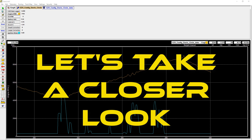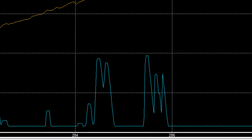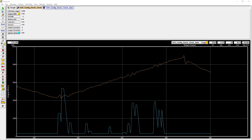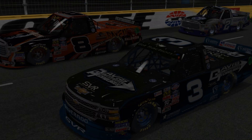Let's take a closer look at that data. If we zoom in, we can see the engine RPM spikes that indicate wheel slip, here and here. If you look below, you'll see corresponding corrections in the timing. So when the tire slipped, the traction control detected the slip and caused a retard in ignition timing to reduce the slip. You can see the timing retard each time you hear the engine speed spike up due to tire slip. You can see this in the LED on the traction control itself, as well as the LEDs on the distributor machine and the LED bar graph on the simulator showing the amount of retard.